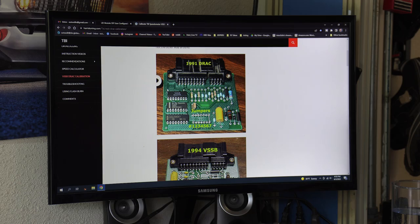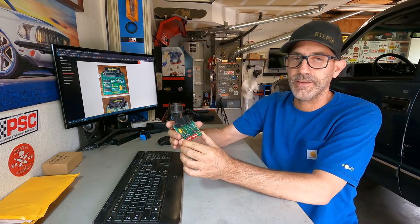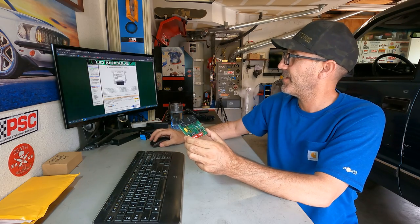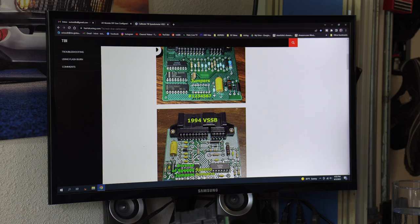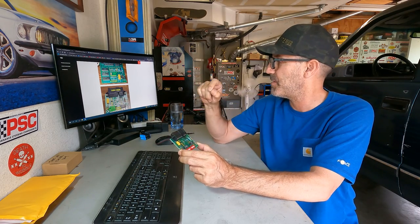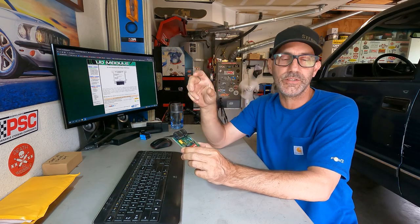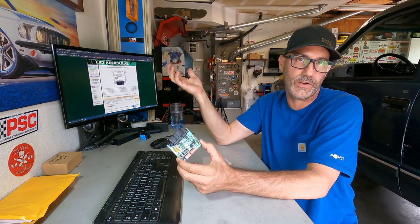I found another site that shows the inside of this module, so we're going to open it up and make the adjustments now. Sure enough, ours looks like this. Here's something interesting though: the dip switches on the one I bought from this site have six adjustable jumpers, but the site showing the code to set them shows seven. I can actually count the solder points — there are seven to adjust. So this is going to get tricky. Here's the basics: we're going to tell the computer to adjust the vehicle speed sensor signal, since on this generation there's no physical gear on the tail shaft of the transmission to swap.